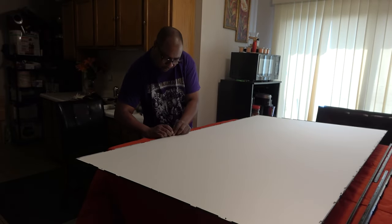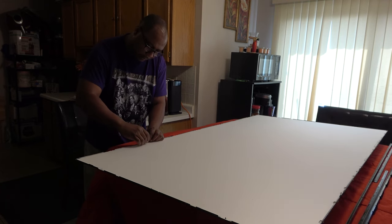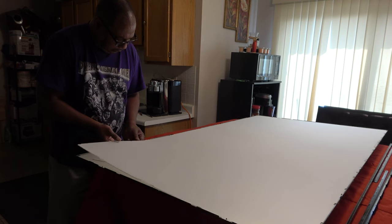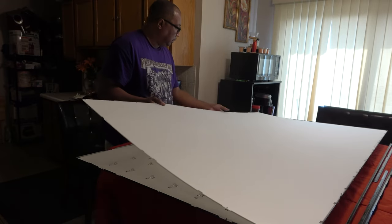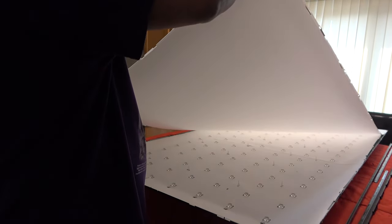Okay, just pull the tape back. It's black tape right here. And sometimes they may have tape on the bottom too. This one does not. Looks like it's tape. And make sure that you keep the diffuser screens all together. Do not reverse them, things like that. If you need to, put a piece of tape on one side, because if you sit it straight up on the floor, they are going to slide apart, okay?